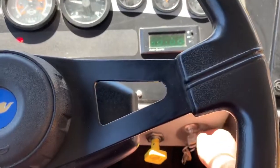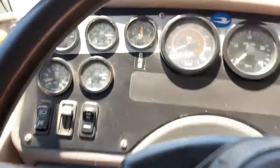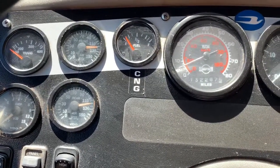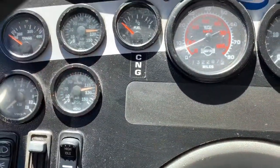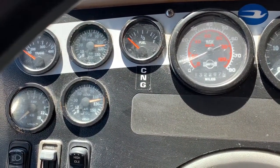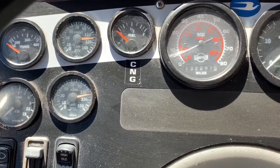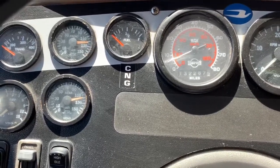For the static test, I'm going to turn off the bus — I'm not touching any of the brakes — and sit here and wait for one minute. The air tanks cannot lose more than two pounds in that one minute. I'm going to tap the gauges to make sure they aren't stuck. There's no clear way to distinguish between two and three pounds on the gauge, so if my needles move at all, I'll say it failed and put the bus off the road.